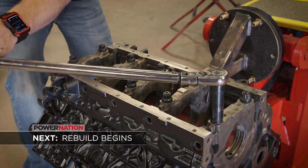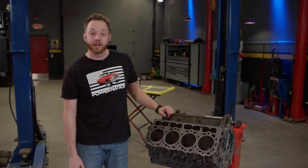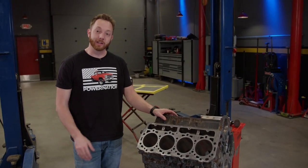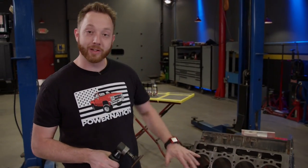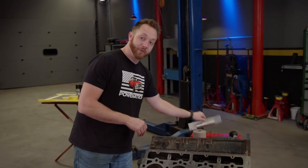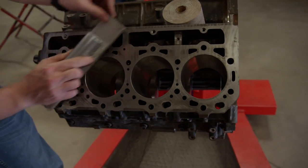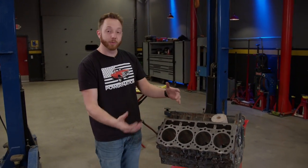With the engine back, time to get to work. We've got our Duramax block back from the machine shop — it's freshly honed, line honed, and they threw in some new cam bearings and stuck it in the jet washer. But the rest of the cleanup is on us. The deck surface is one of the most important things to make sure is clean and flat. A lot of guys are tempted to grab an angle grinder with a Scotch-Brite pad, but this removes a lot more material than people give it credit for — do not use that on a deck surface. Instead, use a flat piece of aluminum and some 180-grit sticky-back sandpaper. Spray the deck surface with WD-40 and go to town flat, so the head gasket will seal and there's no chance combustion pressure will escape.